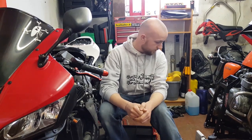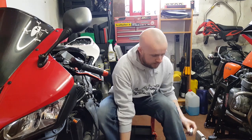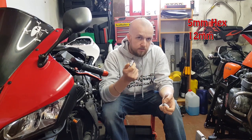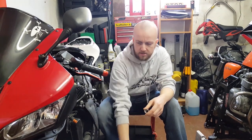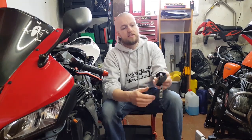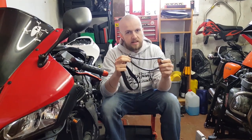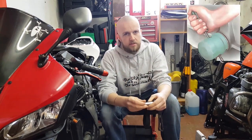It's not a hard job. You're only going to need a few basic tools and a decent wrench with a few adapters. You'll need a 5mm Allen for the fairing, a 12mm for the sump plug, and a 17mm — in our case, because we've got a K&N filter installed which has a nut welded on the end. If you haven't got the K&N filter, you'll need some kind of wrench adapter — there are strap style, chain style, or pliers style options.